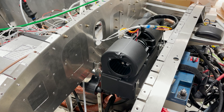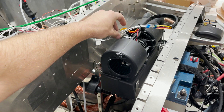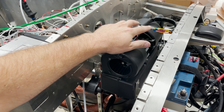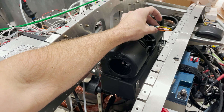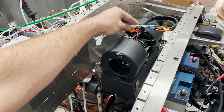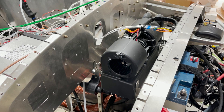The next step is to establish your heater wiring. I like to clip off the wires and use solder sleeves to 14 gauge cable, instead of using a connector here as well as a connector at the switch. Yellow is your low speed fan, orange is medium speed fan, red is high speed fan, and black is ground. You'll run your ground straight to your ground bus and the other three will go straight to your switch on the dash or panel.